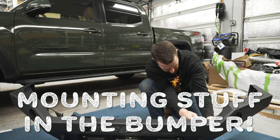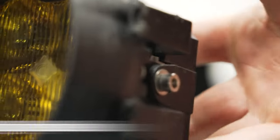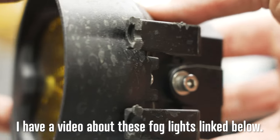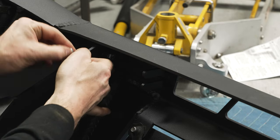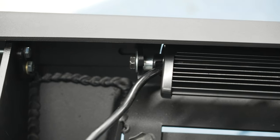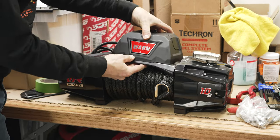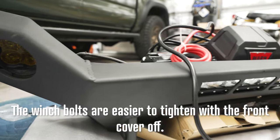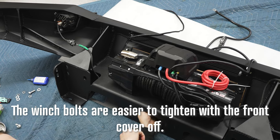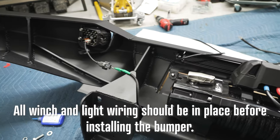Time to mount the lighting and winch into the bumper. I started with the fog lights, mounting them in place using CBI's supplied brackets — I needed to trim off part of the plastic bracket to make the fog lights fit as snug as possible. I then mounted the Cali-Raised 20-inch light bar: first I installed the supplied brackets from CBI, then the light. The light bar body itself was a little short, so I had to use some zinc spacers and extra-long bolts to secure it — from the outside though it fits just fine. I prepped the winch by removing the control box from the body using an Allen wrench to remove the center bracket, disconnecting the box, and reinstalling the bracket. Mount the winch into the bumper with Warn-supplied hardware — do the back bolts first, then the front two when the bumper is on the truck. Install the positive and negative wires to the back of the winch now while it's still easy to do so.